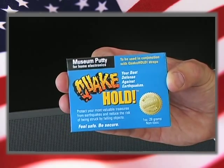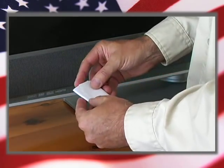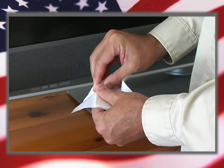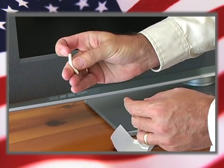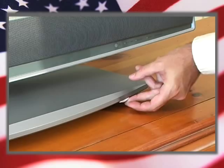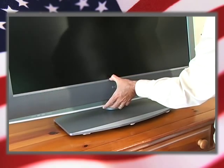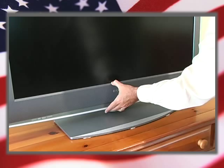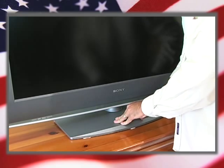When you've secured both straps to the back of your TV and if you want a little bit of extra security, now you can use the Quakehold putty that I mentioned at the beginning of the video and put it under the front of the TV. This putty is really easy to use — all you have to do is take it out of the packet, peel off a little bit and roll it up in your fingers just like this into a ball or a strip. The putty is very pliable and it will stay in the form that you make it into. So you've got your three or four pieces of putty — put them under the base at the front and then press it into place. The last thing to do is just press on the base of the TV to make sure the putty stays in place.